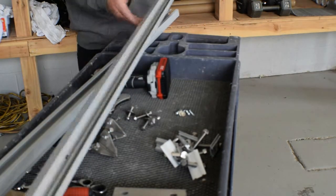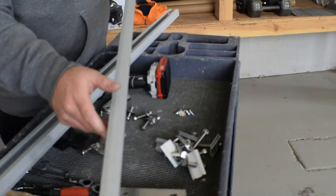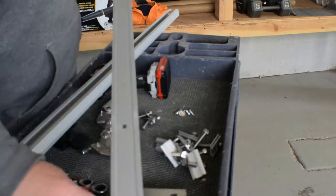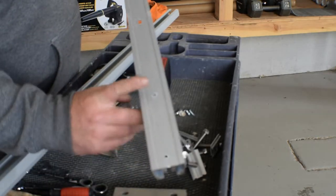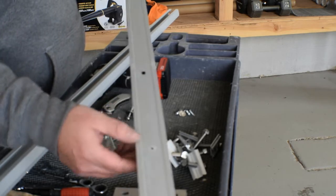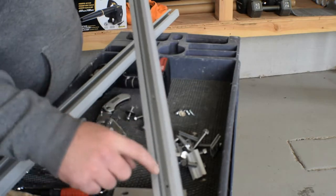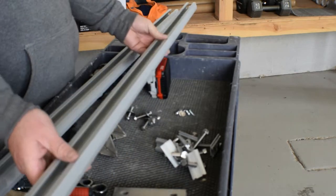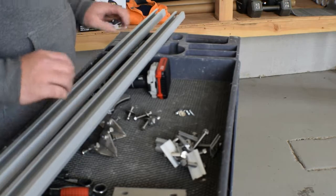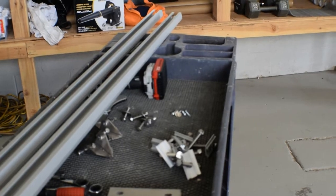There's the two rails. You'll see that there's mounting points for the bolts to go through. There's also two sets of holes. So if you decide to turn the rails for your tent to deploy off the back of your vehicle, when you cut these off, there'll be a pre-drilled hole for where the self-tapping screws go through. So with that, let's start putting the stuff through the floor and getting the rails attached. I'm going to move this over this way now.